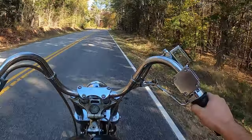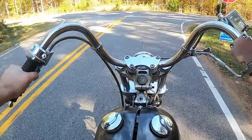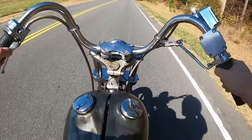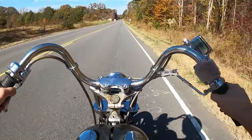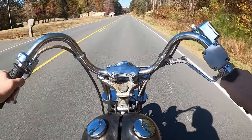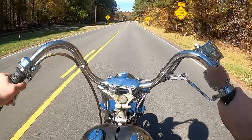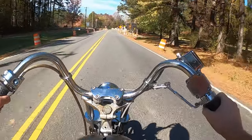If you watched my last episode, you might remember I was having some issues with it spitting and sputtering. I might have knocked the choke off too soon. Doesn't seem like it wants to idle. Second gear is super duper hard to find — you've got to really kick the shifter up. Third gear's not as bad, but these forward controls are going to be the next thing to go. They are not comfortable for me, I don't like how they look, I hate the way the shifter shifts — there are so many linkages and just garbage in the way.